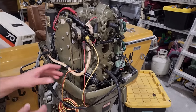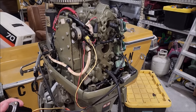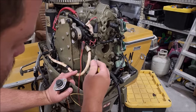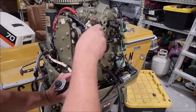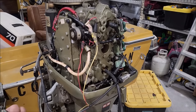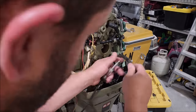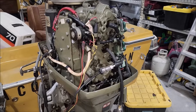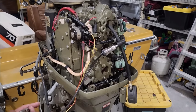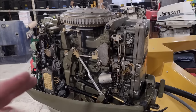The bottom cylinder was run with water, so it might be a little lower than the rest. We'll see. I hooked up the start button wrong and caused a short to ground on my switch — whoopsie. Okay, we're getting spark. Compression's just shy of 150. It'll run fine. Spark, 150 on the next cylinder. Spark, 150 again. We know our ignition is working and we have good enough compression.